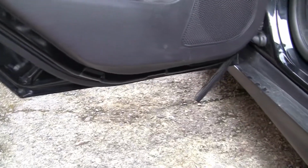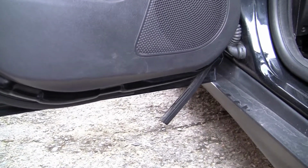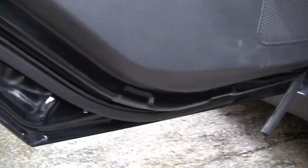So there's nothing that actually holds this in. If you're thinking it fits in some clips or pushes in some holes, it doesn't. And I think even at factory, it's just kind of glued to the bottom. And I've done this, it's been on probably about 2 years till it's fallen off again, but you've got to use the right stuff, and there's two different versions of it I'll link to in the description. But basically I've used double-sided tape under here, I tried contact adhesive, I tried all sorts of different stuff and it fell off. But what you've got to do is you've got to clean the underside of the door as well as you can, get it all really nice and clean and tidy, and then I get some double-sided tape.